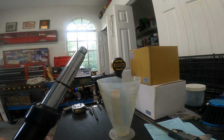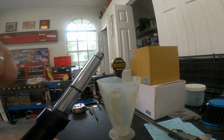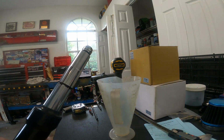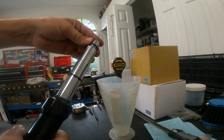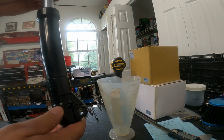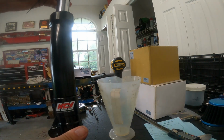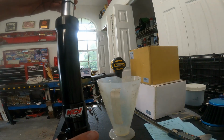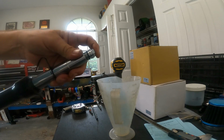And for that last test we did with the race sag, I weigh 190 pounds, if that gives you any indication. So these are way too undersprung for me. Remember, these Roughhouse 50, Buddy 50 forks are made for a Roughhouse 50 or a Buddy 50. That bike weighs a lot less than your Mad Dog, and I'm guessing the riders that ride those weigh a lot less. Just saying.